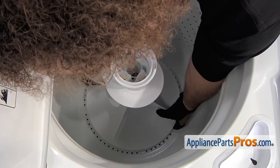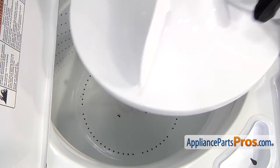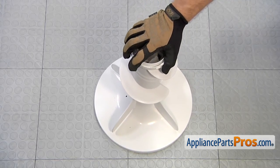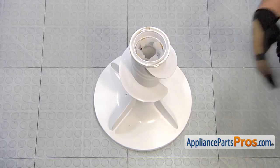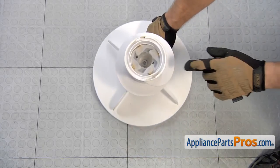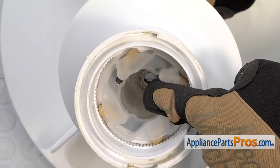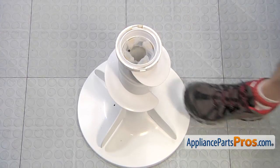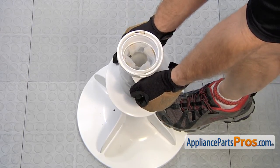Sometimes if it's tight, you may have to reach down and pull the whole thing out. Once you have the agitator broke free, you can lift it out of the washer. Now that we have the agitator out, we have to take it apart to get to the thrust washer. If your agitator came apart and the bottom half stayed in the washer, you don't necessarily have to pull it out — you can just put the thrust washer in there and put the agitator back together. Inside the agitator, there are two locking tabs that hold the agitator together when the bolt is not in there. To get it apart, all you have to do is stand on the base of the agitator and pull up on the top part and they'll release.